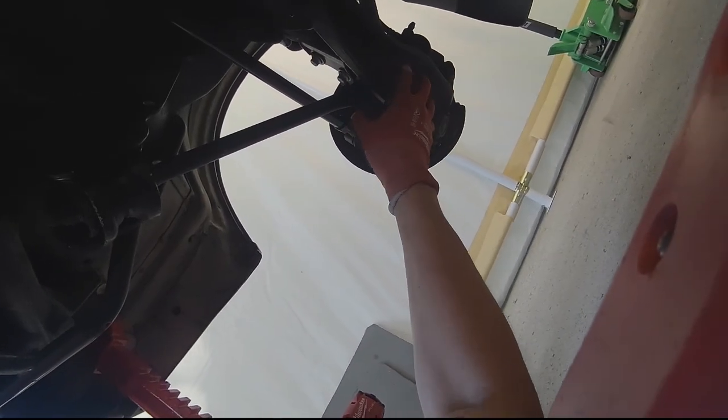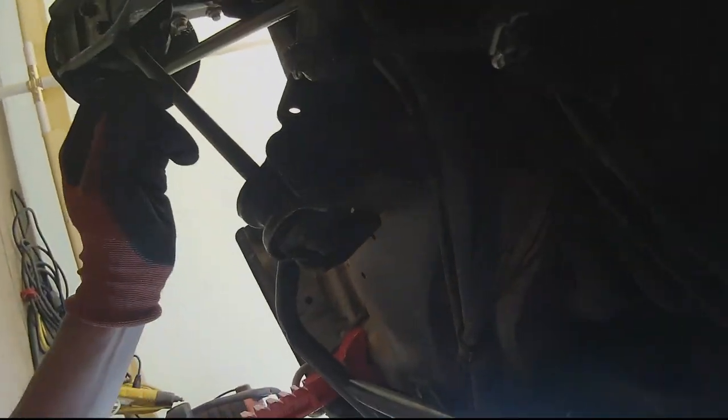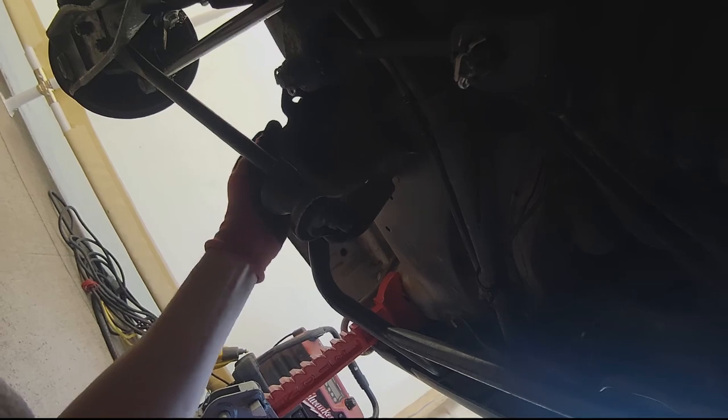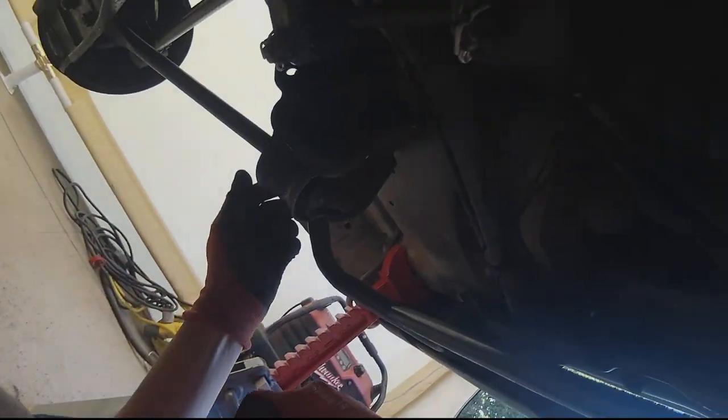Okay, finally, after spending an hour retooling everything here that I last used about 2 months ago, I'm underneath the truck. Since I don't know what I'm doing, I'm going to start with what I think is the easiest. I'm going to remove this control arm, which is two bolts on the lower arm, and then this one bolt here, and I should be able to slide everything over. That's a 14 millimeter on the bottom.